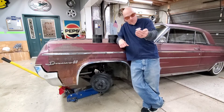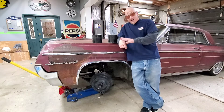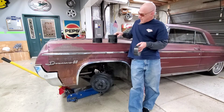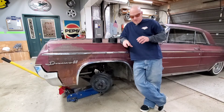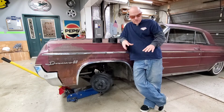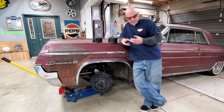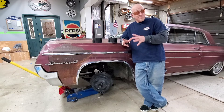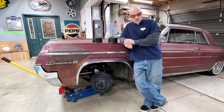It never was as low as it should have been and I never filmed putting the newer stuff I had built back in. What I did was I got two inches cut off of the bag mounts. For some reason the car sat about three inches higher, and when you set the old upper and lower bag mounts and the new bag mounts side by side, there was only an inch difference. I went from a 2600 to a 2500 bag. I don't know that that should have caused any issues because they have the same collapsed bag height. The old bag mounts were a little thinner steel and offset a little. I don't know if that would have caused any issues, but this is what I'm going to put back in there and I have a feeling it's going to drop it down pretty good.